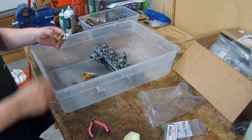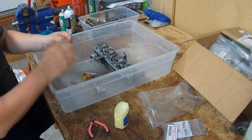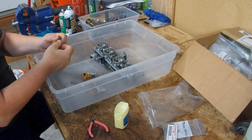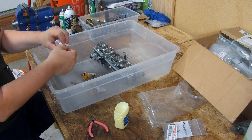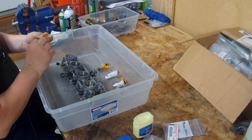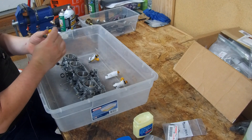Finally, I want to put the O-rings on the end of the injectors. I'll put a little bit of lubricant on the edge of the seal and just slowly work it around so it sits correctly, then repeat for the other three injectors. Now I'm going to lube each end of the injector and repeat for each injector.